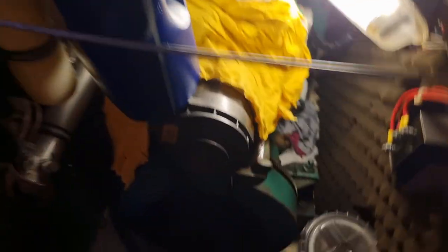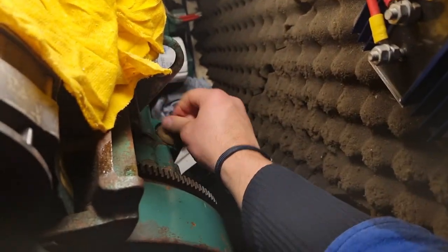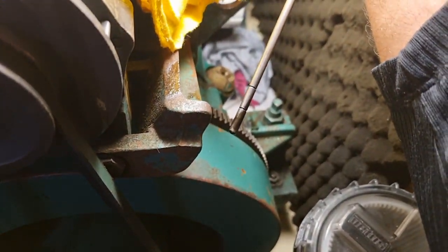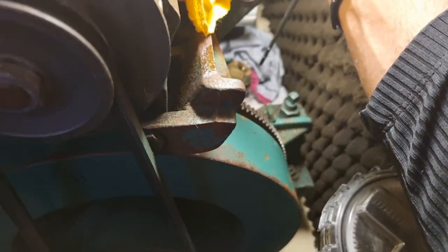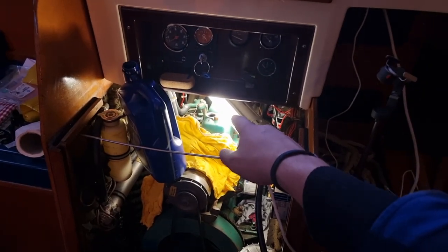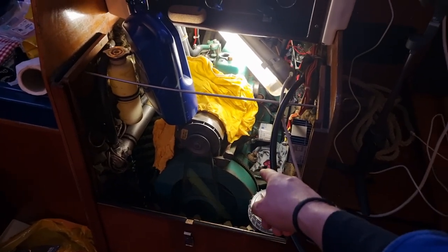Now I've been refilling. Wait a while, then go to the dipstick and after about 10 minutes check how much oil is in. It should be around mid-level. Don't overfill these engines. Just wait a while because the oil is still dripping down to the bottom of the sump. I hope you enjoyed this short video of how to change the oil on a Volvo Penta MD-11 from 1978. Leave a reply in the comments. See you, peace out.